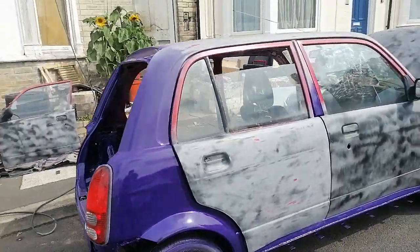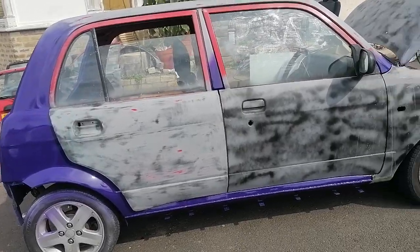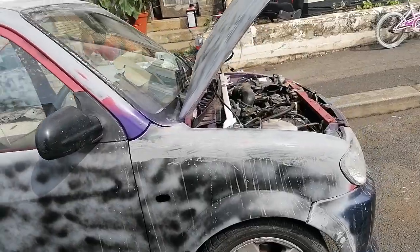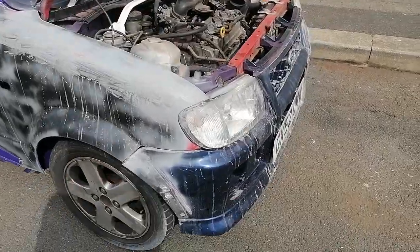Makes sense, all the work over the years on this thing. Sills, a few black patches in the back, a plate on the front of the chassis leg - and that's about it really. Welding wise, there's not much left of it originally.